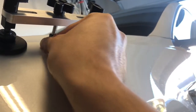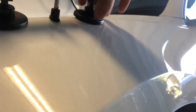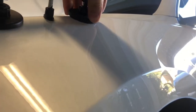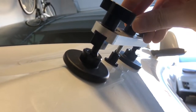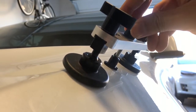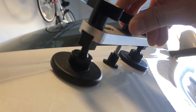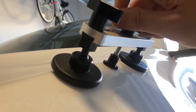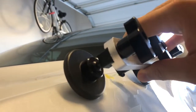Here I'm just cleaning up the area while I wait for the glue to dry. I usually wait about three minutes to let the glue dry up before I pull on it, because there's no point pulling when the glue isn't fully dry — you end up wasting time and not actually pulling the dent out. You want to crank on it slowly at first to pull stress into the paint, and then once you know it's about to pop, turn it quickly for a little jerk upward to help pull the dent out.